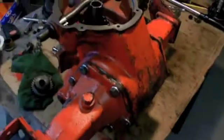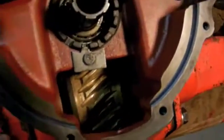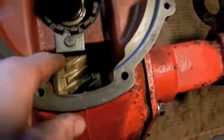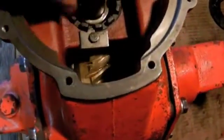But so far, I got the red transmission back together. I had this all apart, the casings have all been washed out. What I did do is change out the brass ring gear with the solid style one, because the other one had a crack in it, which I don't think I mentioned. So that's all set, the differential's been taken care of, Swift-O-Matic, everything shifts as it should.